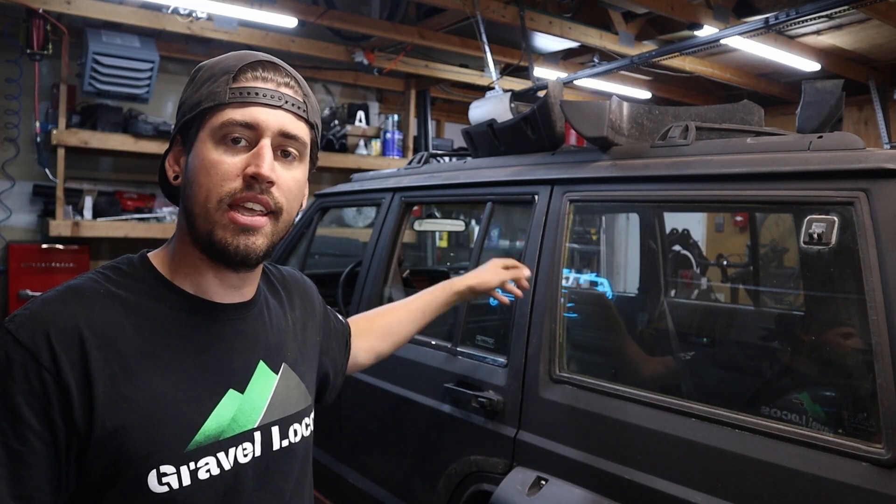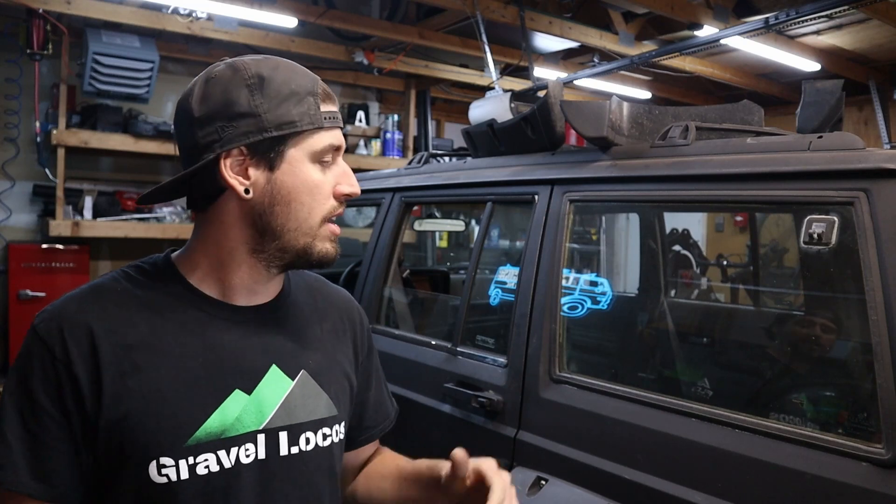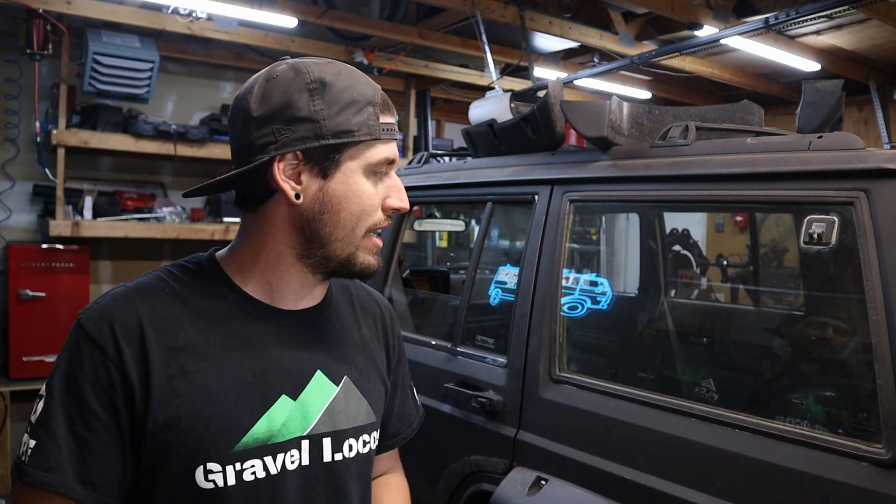A couple of things I'm still waiting on: I need to start the B-pillar portion of the cage, and once that B-pillar is welded down, I'm going to run seam sealer along all these new floor pans, all the slider welds — everything — just to get it all smooth, sealed up, and then paint everything. In the last video I did mention raising the tank up in the floor. I'm still debating on that; the biggest thing is I want the filler neck outside on the body, but it's starting to seem like a little more work than just building a gas tank skid.